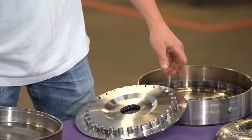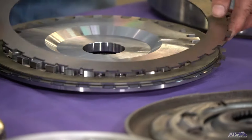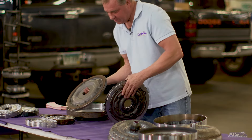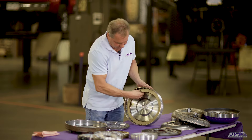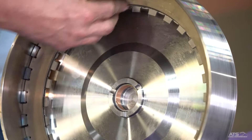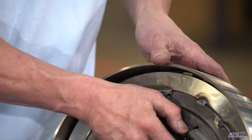We've built a clutch pack that fits inside the torque converter. This clutch pack engages on the inner and outer tabs, creating a clutch pack effect inside the torque converter. Instead of a wimpy single disc, you now have five discs that rotate independently inside the torque converter. These clutches spline into the cover of the torque converter, so you get a clutch pack effect that gives you 100% application of torque when you squeeze them all together. When applied, they latch together and give you the ability to hold just about any level of torque you want.